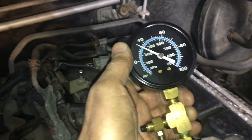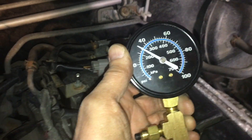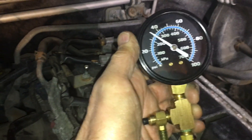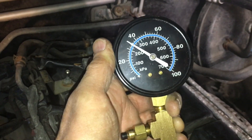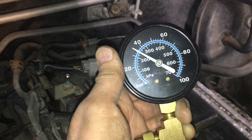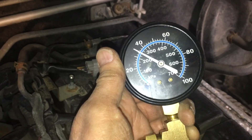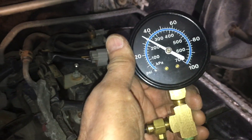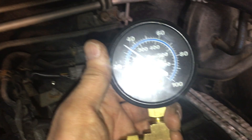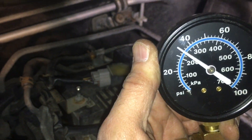There's nothing wrong with this vehicle — this is just my test vehicle, so I'm not expecting to see a significant split between the injectors. The accepted norm is about one to 1.5 psi difference between injectors for things to be considered serviceable. A greater drop is synonymous with a leak. If we have less drop, that indicates a restriction — likely the inlet filters on the injector tips are clogged. It's important that you start each test at the same pressure.